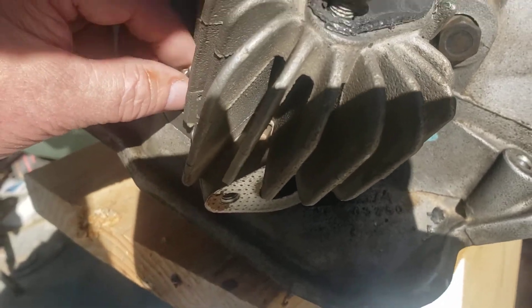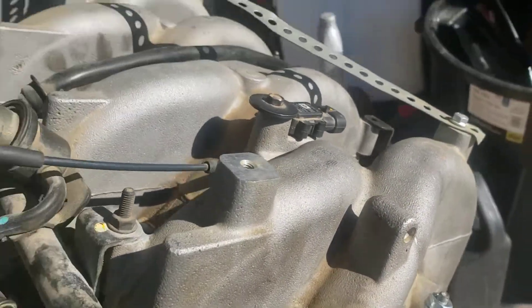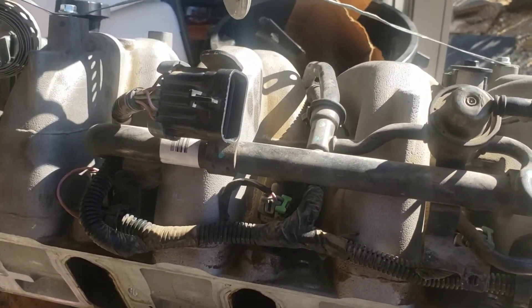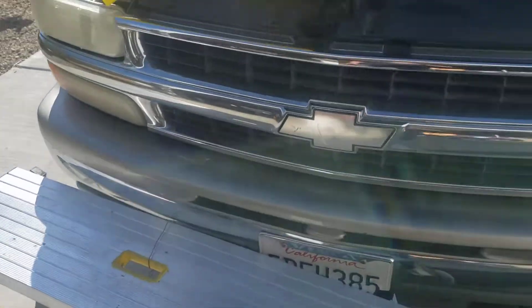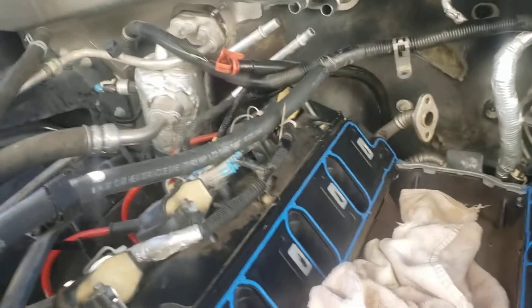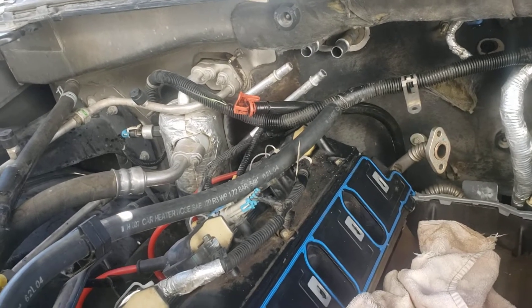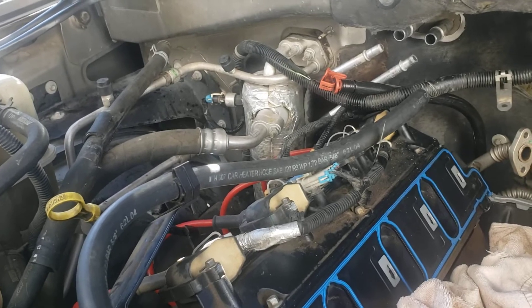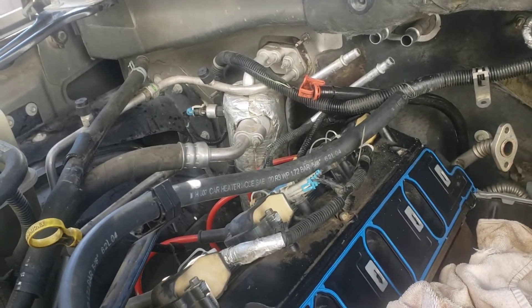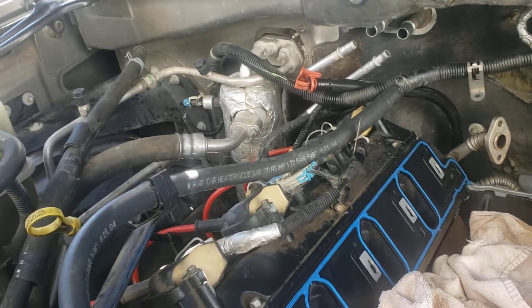It's easier to take this little chamber up here first, then loosen it, and then you can pull the manifold straight out. You can see I've got it suspended on an engine hoist, getting ready to put it back in. Along the way I bumped the heater hoses and both of them were crystallized — they both broke. I have to replace the heater hose quick-connects, which I found, along with the connectors. Those things are really hard to get off.